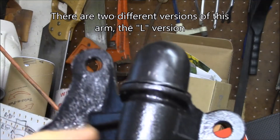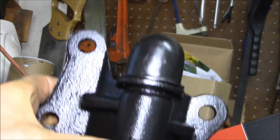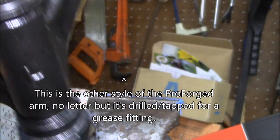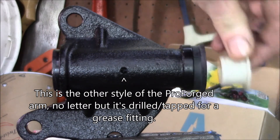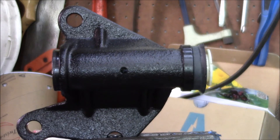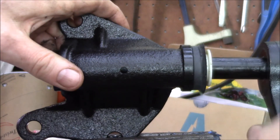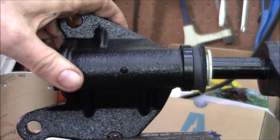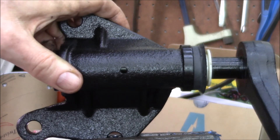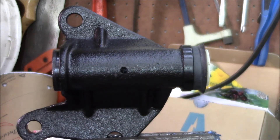Here's the face of the arm — it's marked 'L,' which I think stands for left-hand drive, so this is built to run on the passenger side, the right side of the vehicle. Just to show you one of the benefits: here's the original plastic bushing that we replace. I'll tap it in and show the idler arm with the round shaft. With just one plastic bushing you can see how loose it is — I can just wiggle it around — though it's tighter when you engage both bushings.